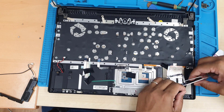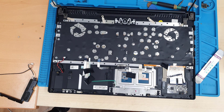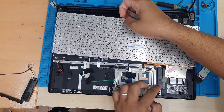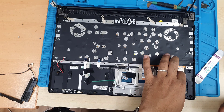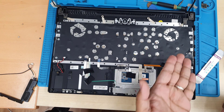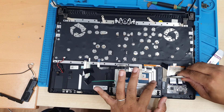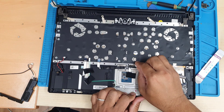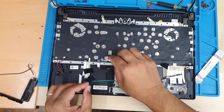Make sure you peel the tape off to disconnect the actual keyboard connector. As I said, the replacement keyboard doesn't come with any flex cables, so we have to remove the flex cables from that side and then later remove them from the actual keyboard side. Peel those cloth tapes off and we're going to cut them one by one.